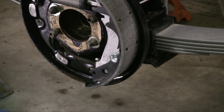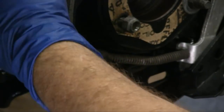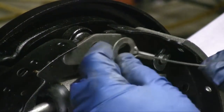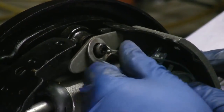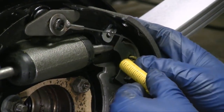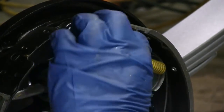I'm going to make sure my gloves are clean and we'll move to the front side. Wear gloves because you're going to be handling these shoes for a while. First thing to go on is this diamond-shaped piece that holds the plates together and keeps them lined up. Next thing to go on is your wire — this needs to go back behind here and tie into the next piece, which is your wire loom or run. That goes in there in the hole. Then you have your spring, which inserts inside of this, rolls around, and hopefully attaches to hold all that in position.